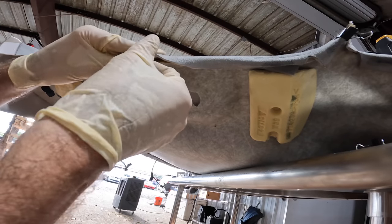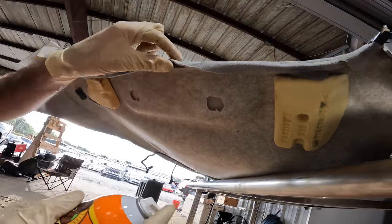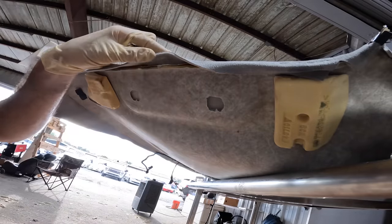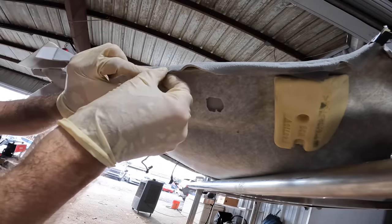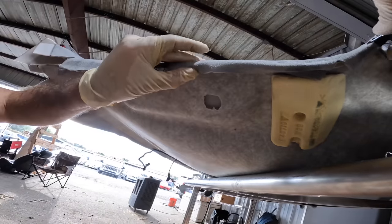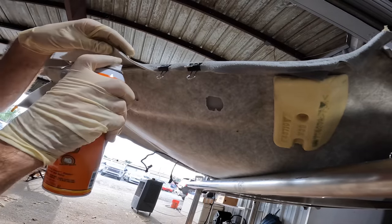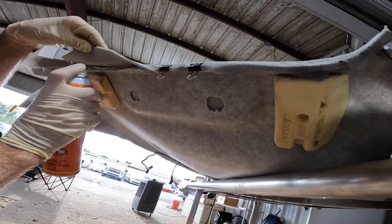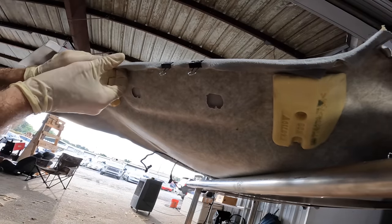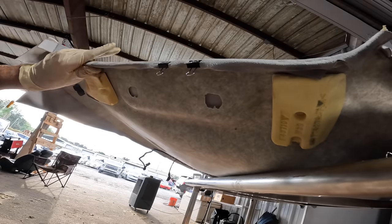See right here, we got to get in here and then pull this back, and what I'll use is a couple clips to keep some pressure on that so the glue sets up really nice. Let's get in there some. This is the detail work here. See that? Pull that around and then get one of these clips in there to hang on to it. Keep it tight. Another one right there. Wrap that one around, tuck it in. There we go. I think that's going very, very well.